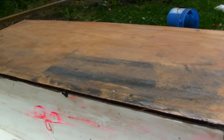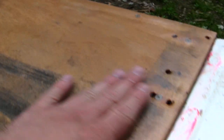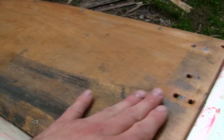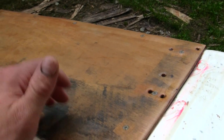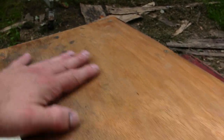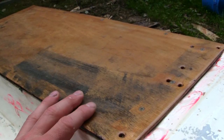The fiberglass is thoroughly dry. If I bring the camera in closer, you can see that the surface is absolutely smooth, and the wood grain is completely and utterly blended over. The hull is going to be going into sanding and refining in order to just smooth it out even further. Because right now, there's ripples and waves, you know, because of the way it was smeared on. But regardless, this is much more easily addressed compared to the other techniques. And at this point here, the wood, at least on this side, is basically plastic. But I'm not done yet with the fiberglass.